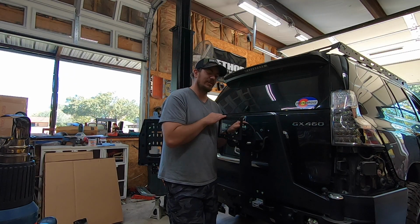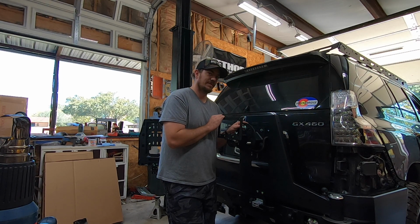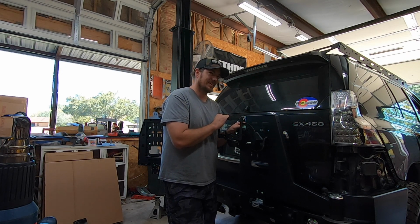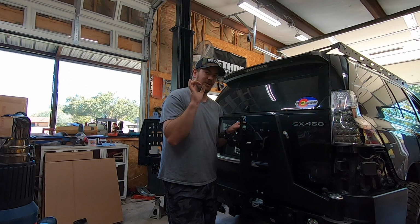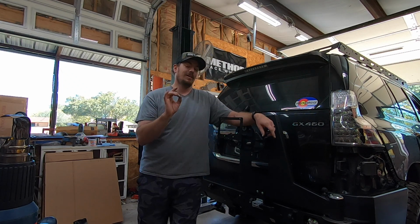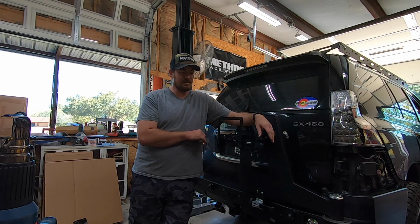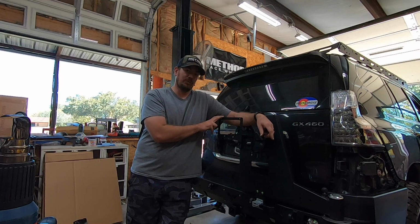Yes, Mr. Young. Yes, sir. My mama told me that you did a black GX just like this not too long ago, and his wheel fit. So why doesn't this wheel fit? The reason his wheel fit is his had TRD wheels, and the hole where the lug nut goes is designed for the washer head OEM wheel or OEM lug nut, not for super skinny fancy lug nuts like these SCS wheels, which, by the way, I like the SCS wheels. However, if you've noticed, we tend to be slightly more loyal to another brand.